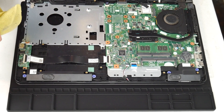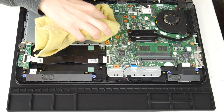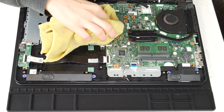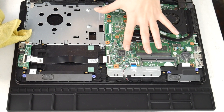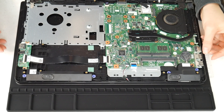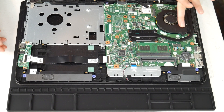I'm going to use my microfiber cloth with a 70 to 90% alcohol solution and I'm going to wipe off any liquid spills I see on the board, inspecting the whole board and gently cleaning off any liquid, because this can make connections that aren't supposed to be there on the board. If you remember any specific spot getting some liquid, you may even need to take off the motherboard and check the underneath, making sure to clean it and ensure it's dry of any alcohol before turning it back on, because this is a big cause for overheating.